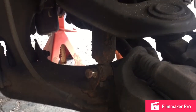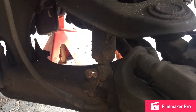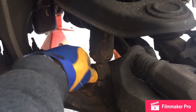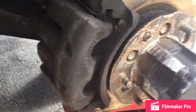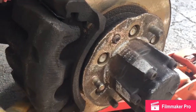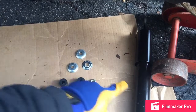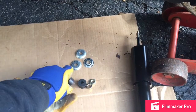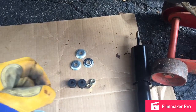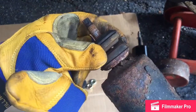The 17mm will come out and this whole thing should pop right out. Once the top nut's off, I'm just going to wiggle this out of here. Before you do the job, make sure you support the vehicle with jack stands. I got the jack lifting up just so I can put pressure on the joint to give me some leverage to wiggle it free. The kit's going to come with the new shock and the hardware — a couple washers, some rubber grommets, and the nuts. The original hardware is a little different, possibly because it's generic.